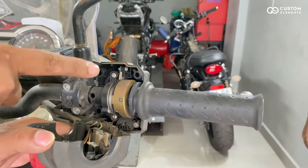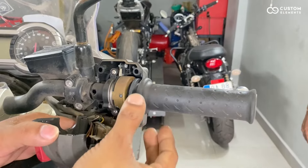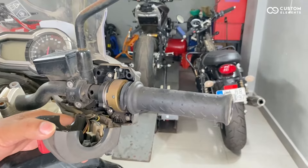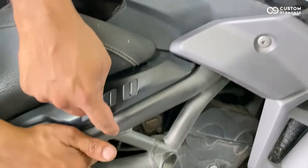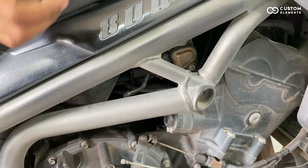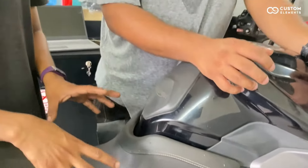What does the sensor do? Basically, the sensor, depending on the twist of the throttle, sends a message to the ECM. The ECM in turn sends a message to the sensor on the throttle body to open the flap — the throttle flap. That takes the feedback — total feedback. The ECM sends the feedback to the injector on how much fuel has to be sprayed. And based on the flap, how much air intake and the fuel mixture is decided.